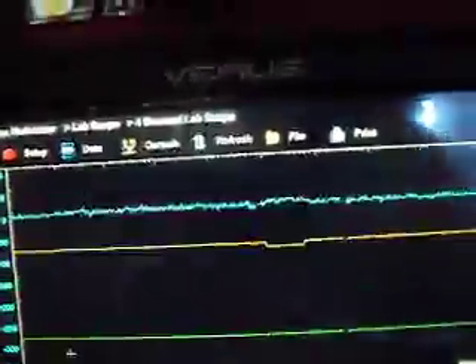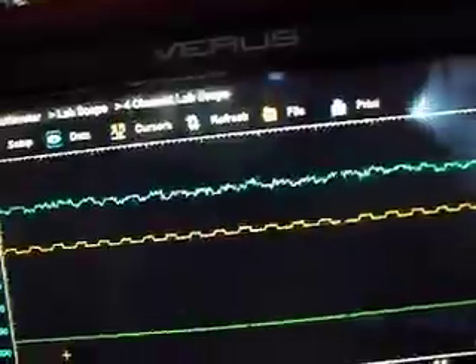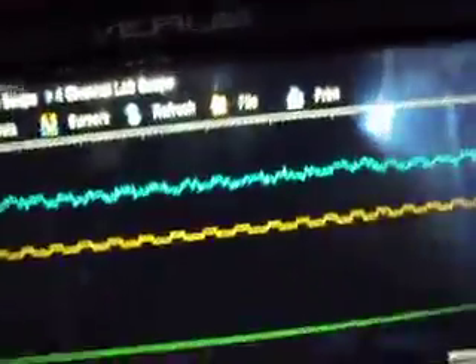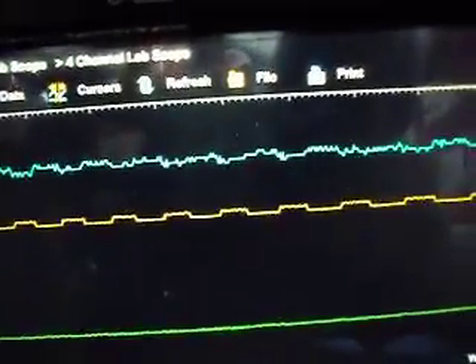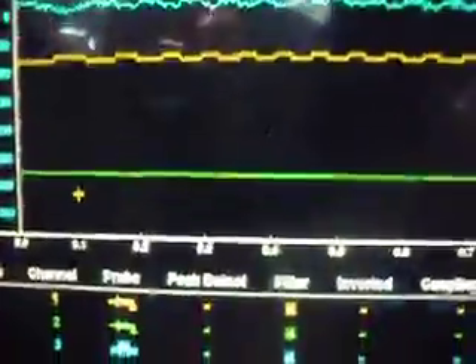First of all we'll spin the tire here and see what happens. We can see that there is a small amount of amperage, maybe around 5 milliamps, and we got about half a volt of variation in our supply wire. But as you notice, the green wire — the vehicle speed sensor signal wire — stays right at zero, it doesn't move at all.